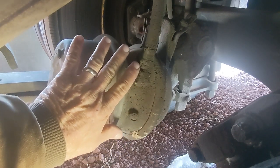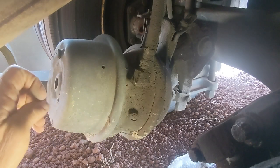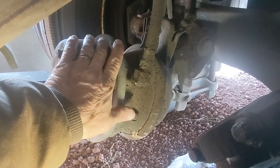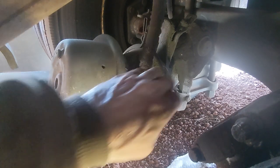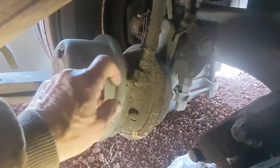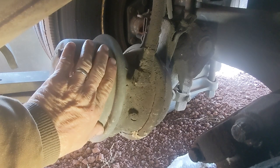The beauty of modern spring brakes is: if you lose air pressure in your bus — it leaks out — the spring will push that shaft back, applying your rear brakes. These are only on the back of your bus. When you push the knob up front to release your brakes, what you're actually doing is filling this canister with air pressure, which pushes back against the spring and releases your brakes. When you apply the brakes, that air pressure pushes the shaft back, but the spring is held back and restrained by that air pressure.